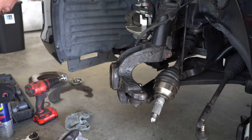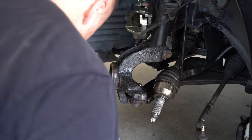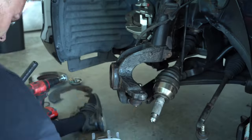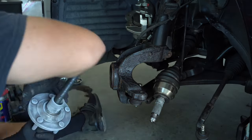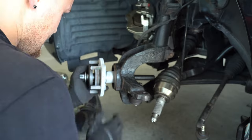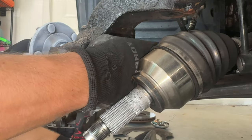Finally, it's time to install our new hub. This time, we need a step washer small enough to fit on the inner race of the wheel bearing on the backside of the knuckle. We will also need a step washer small enough to fit in the hub itself like before. Then we need to tighten everything down. You'll know when it's bottomed out.